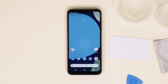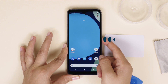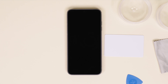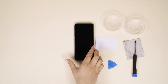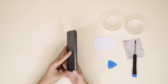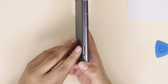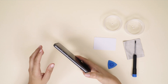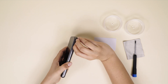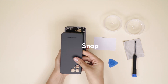Since we're taking out the battery for this one, make sure your Fairphone is turned off by pressing the power button on the side of your phone. Now let's take off the back cover by separating it from the aluminum frame with your finger. There is a designated notch on the bottom right side of your phone when the screen is facing down. You'll hear a nice click once it disconnects. Make sure to start there and work your way around until the back cover comes all the way off.